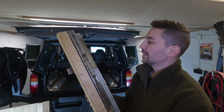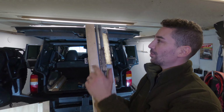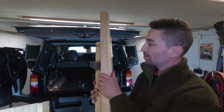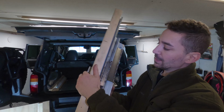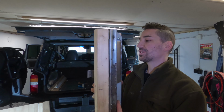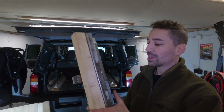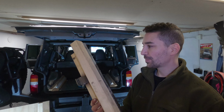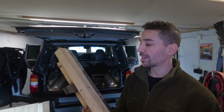And I call it a prototype because it didn't work, but if it did work, it wouldn't be a prototype. Wise words. But you can see the triangulation I've welded in, even put stiffeners along the top there, triangulation in the bracket too, that kind of connects it to the vehicle. To be honest, they've just ended up weighing so much that they're losing their functionality, and I'm just going to abandon this, and I have done. And it's weeks later, if you hadn't guessed it.